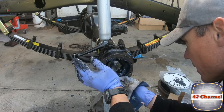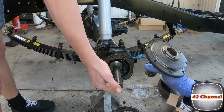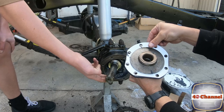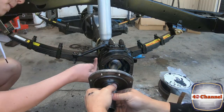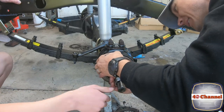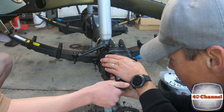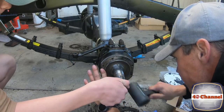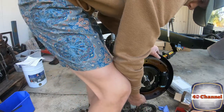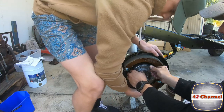Clean that surface off a little bit where the gasket's got to go. Now we've got our spindle hub — we have a drain point at the bottom, so make sure that drain point is at the bottom. Put our gasket on and slide it over the shaft carefully, making sure the gasket doesn't get pinched. Line those gasket holes up, then use a soft dead-blow hammer — just be careful when you put it on. Gasket and oil seal, hold it on — that's it.